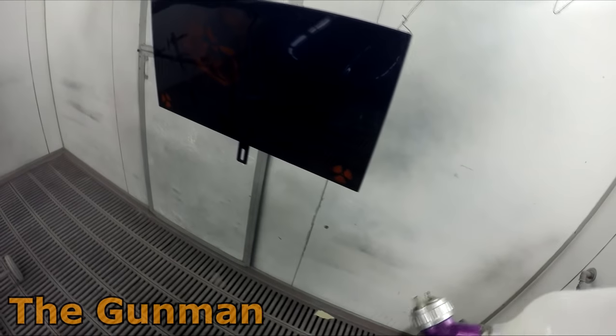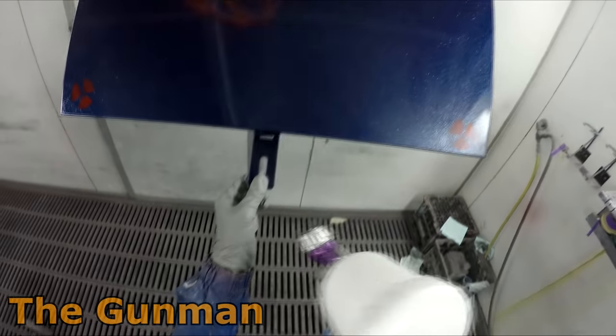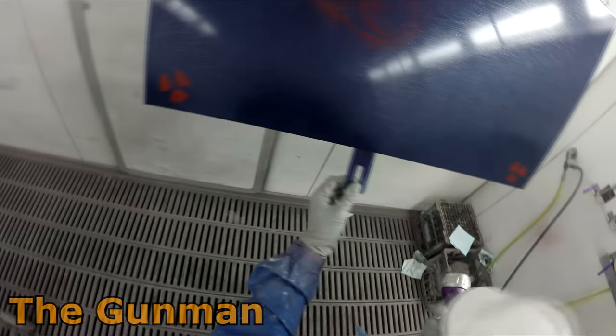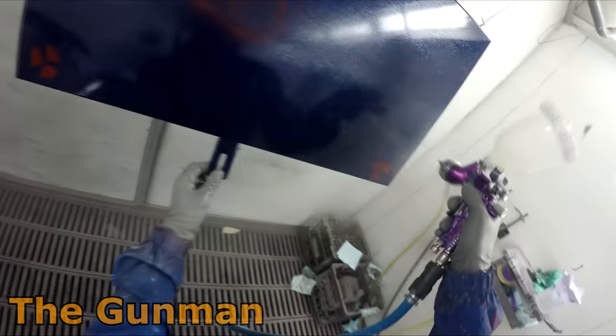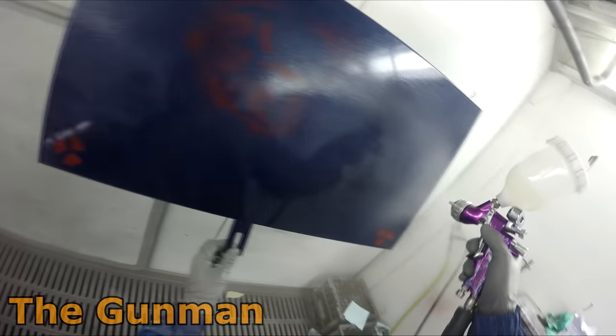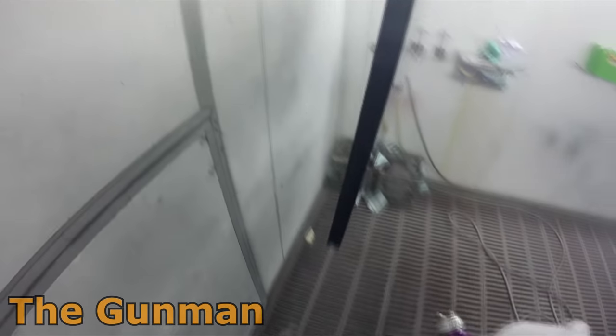So again, it didn't actually get a bake, but it definitely held a very nice deep gloss, something that you'd really struggle to get without buffing, using an MS clear coat and really pumping a good amount of clear on there and polishing the heck out of it. But yeah, the gloss that it retains, it won't really die back as much as the MS clear, and it does give you some good filling capabilities as well. So you know, it was able to fill up all those flakes from when I painted it the first time. So chill out here, watch me spray the rest of it, and thanks for watching, guys.